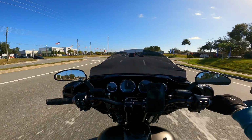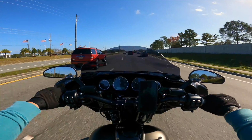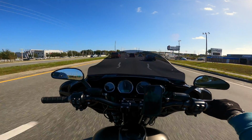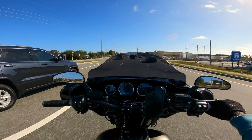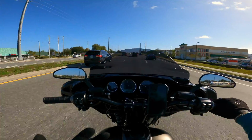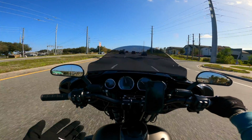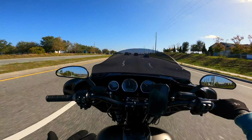Chris has got the bike tuned, or reflashed, with the proper gear ratios now, and that's working just fine. But this issue from third to fourth is dangerous. So I'm going to be hitting up Barnett and Baker this week and seeing what they say about this issue. Hopefully they're able to come to some resolution, because now there have been two clutches in the bike and it still isn't shifting properly. So something has to be going on, especially if it's just that one gear.